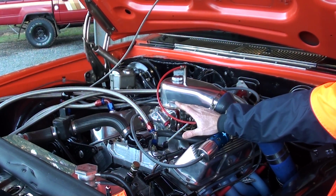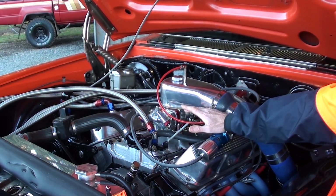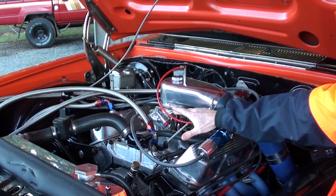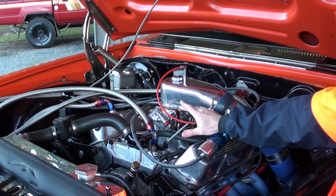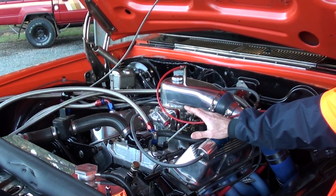They did say around 6 to 6.5 pound, but I got about 7 pound out of this. It was about 8 pound when I dialed it up, but it couldn't quite hold the float level. It would slowly creep up. 7 pound was as much as it'd take comfortably without upsetting the float level. So the more the better. I've got a base pressure of 7 pound.